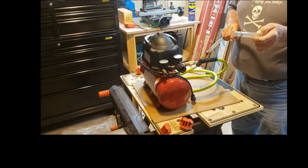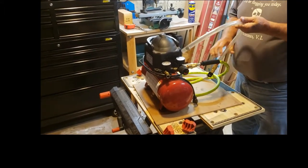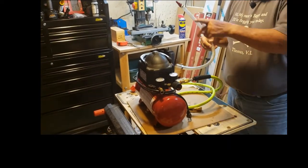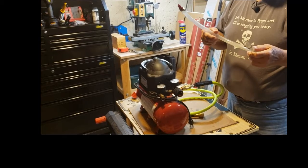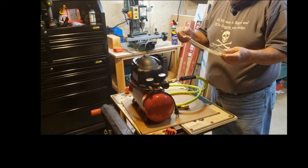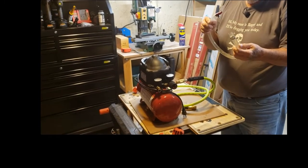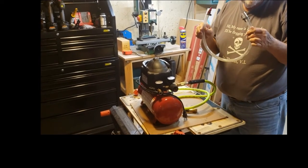Now I use this on the throttle cable and also the trim assembly. It's called a jetivator on the boat, and that cable just goes right through and goes up to a little motor on the transom. But it loosened up the cables. I mean, they were probably corroded, whatever, because the boat sat for so long. But this is how I loosened the cables. And again, some of the bigger cables, Stu at Dangar Marine did, and he's got a fuller explanation of the approach to doing this on his YouTube channel.